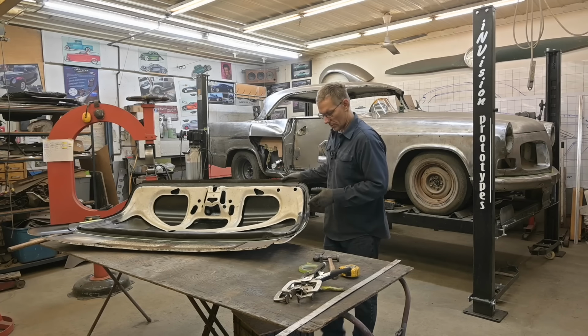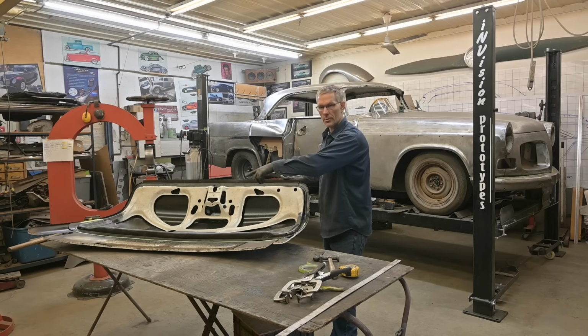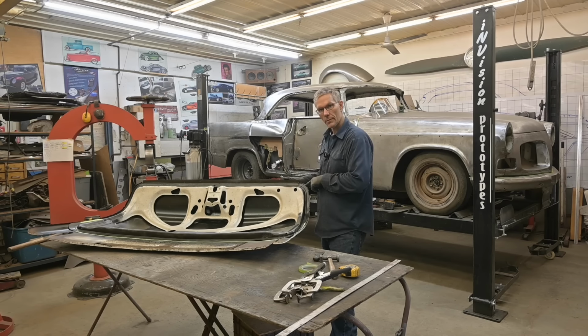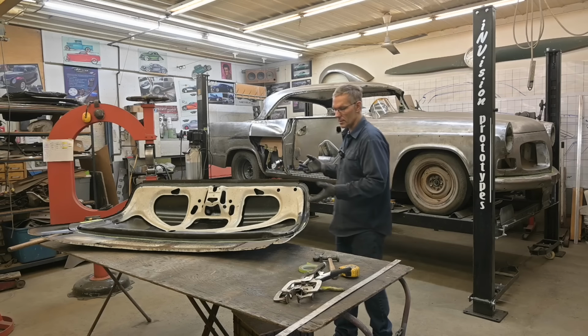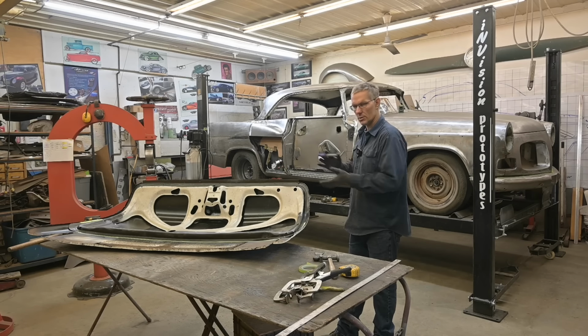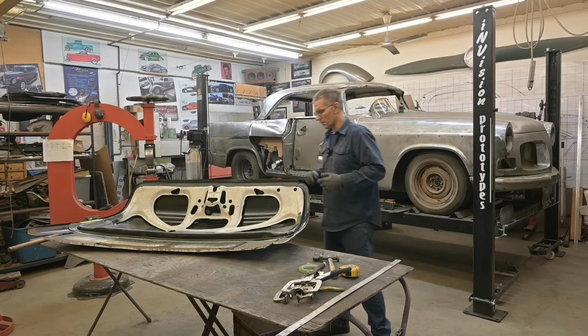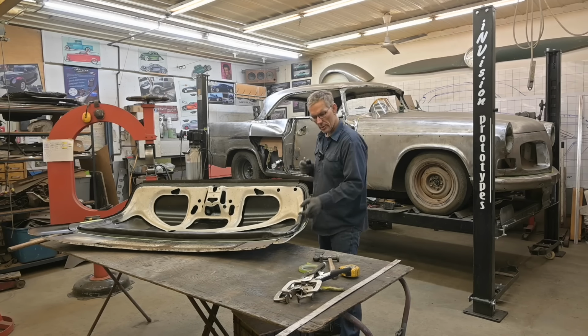When it comes to rolling a flange around the corner, it's 1/2 inch or just under 1/2 inch, probably 7/16, along the long straight edges. When you get to a corner, it's a 1/4 inch. The factory didn't want to fight with rolling so much material over. I don't even know how they do it in the factory. It's amazing how nicely they can pin it on to the structure, just production-wise. But they reduced the length of this flange in this area to 1/4 inch. And that's what we're going to do along the front.